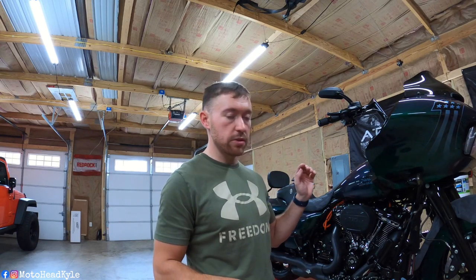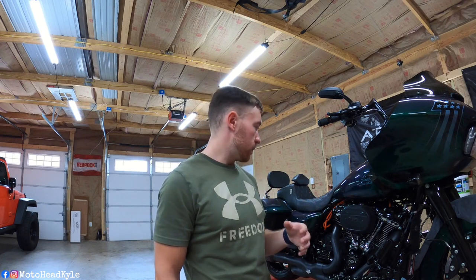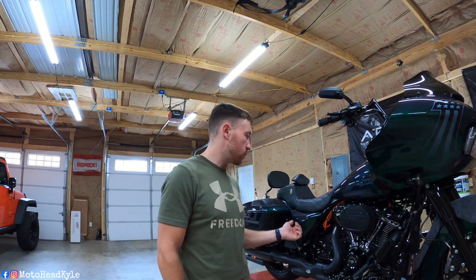Like I said, the bike feels fine, so I'm not going to go too in-depth. I'm just going to double check the torque spec on the caliper, the front axle torque, rear axle torque, check the exhaust, the heat shield, all those, torque all them down. Make sure all my controls are in working order, my handlebars are solid, pretty much all that. I'm going to check my battery terminals, make sure that they're not corroded, make sure they're all torqued down, make sure my seat's torqued down.